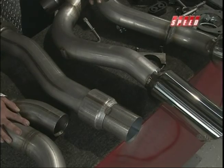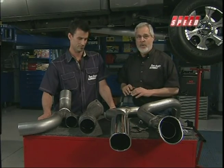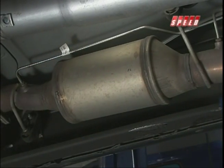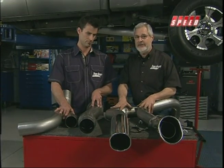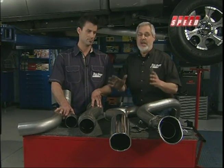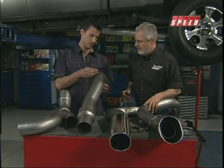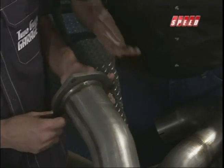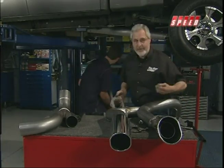We're adding 121 rear wheel horsepower and 258 foot-pounds of torque to this vehicle, and we're doing this with clean tune technology, which is Banks' specialty. We can't put more soot into the DPF — the diesel particulate filter — because they're designed to go a long time. If you load them up, you shorten their life. This thing is 50-state legal and we keep the temperature way down at the tailpipe tip. With all the power we'll make, we'll be at stock or better. It's easy to bolt on right behind the particulate filter — it's got a 3/8 stainless flange. Going to keep your exhaust nice and cool and look great with those big tips on the back.